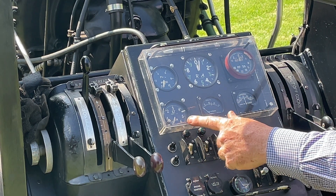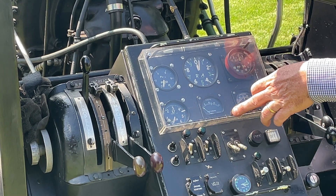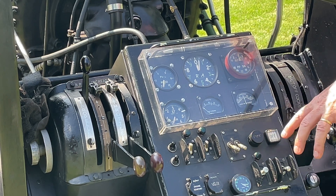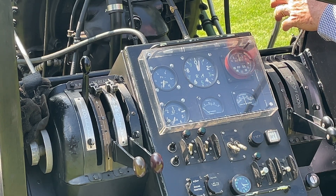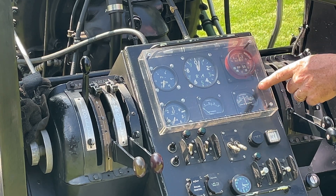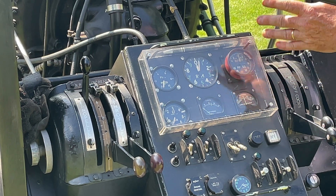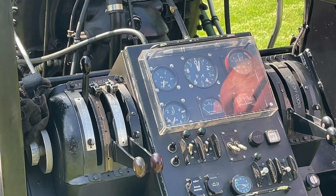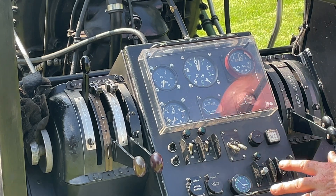This instrument gives me air pressure from the Hymatic air compressor, which is used to drive the pneumatic rams on this trailer. Next to it is a volt gauge giving me a voltmeter and rate of charge. The electrics on this trailer are fully functioning — I have a Lancaster carbon pile voltage regulator driven by the dynamo. Typically it sits slightly below zero until RPM reaches 1300, at which point the batteries start being charged, replenishing the power consumed during starting.